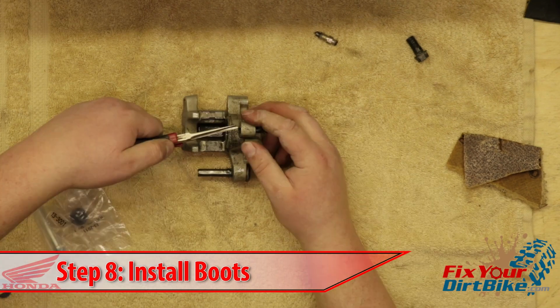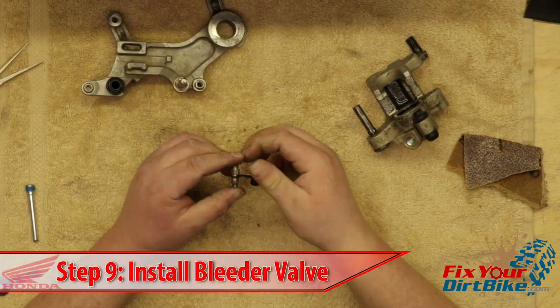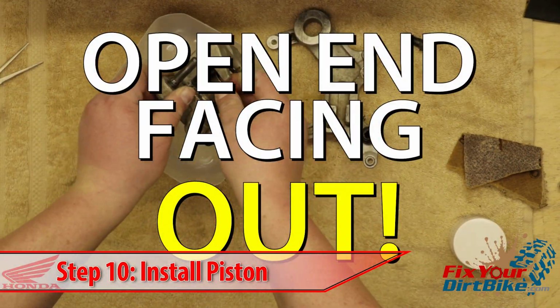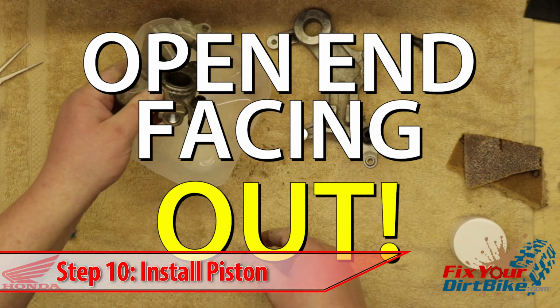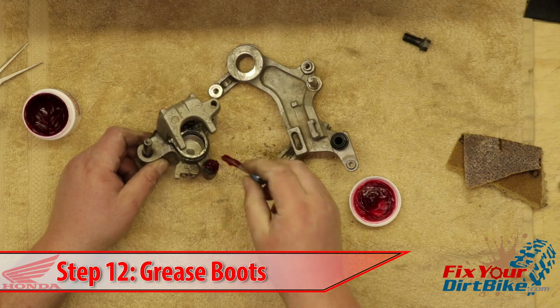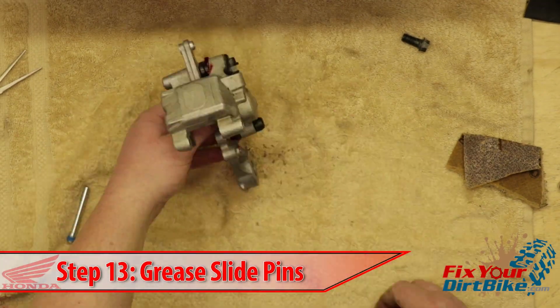Install the new boots. The long boot goes on the caliper, and the short boot goes on the bracket. Install the new bleeder valve cap, then install the bleeder valve. Coat the piston in brake fluid, then install the piston with the open end facing out. Make sure to wipe off any remaining brake fluid. Use your new pad pin to grease the insides of the boots. Add a layer of grease to the caliper sliders and assemble the caliper and the mount.